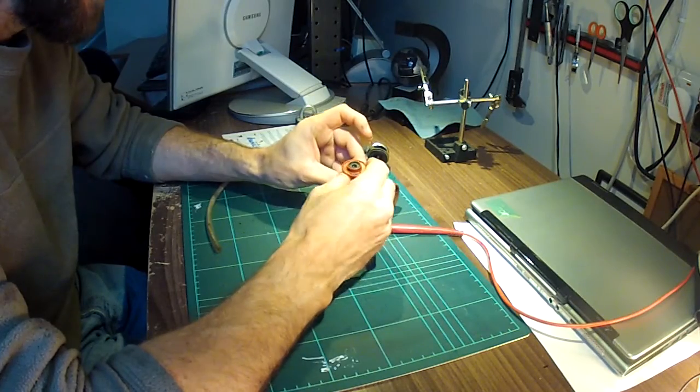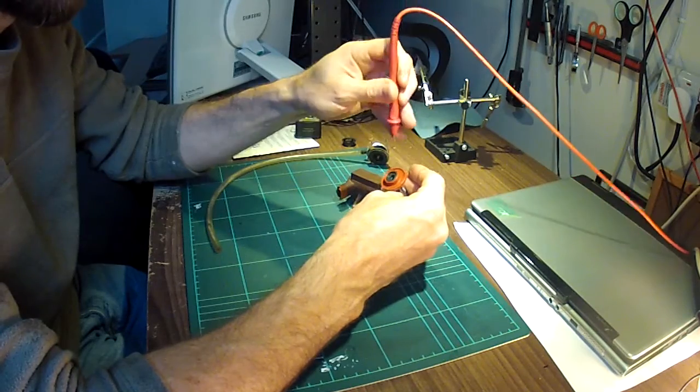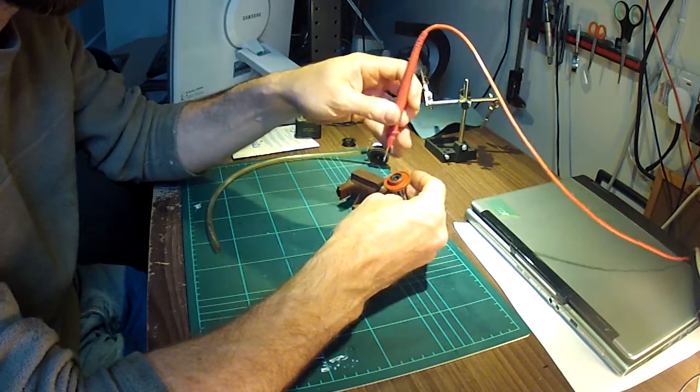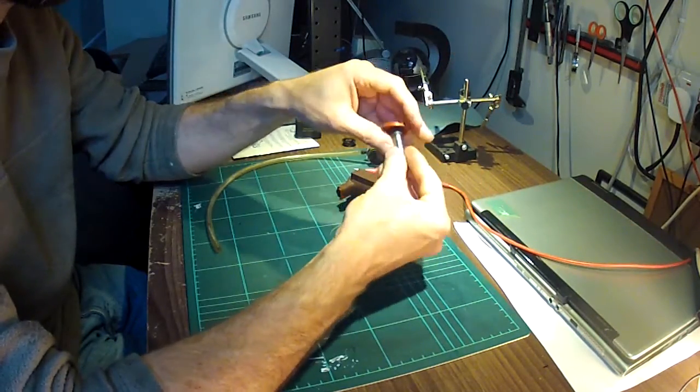The weak part of this really is that little springy valve thing, because if that's stuck open you're not going to get any vacuum at all in the system. Adding a little suck on here — if I push it down you get airflow through here. When I first tried this a minute ago without pushing anything down, I was getting airflow, so I think probably just a bit of debris got sucked in.